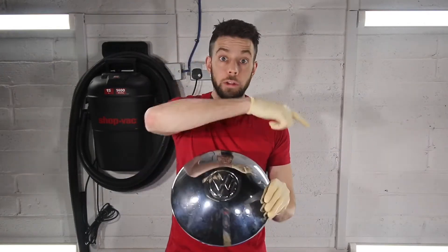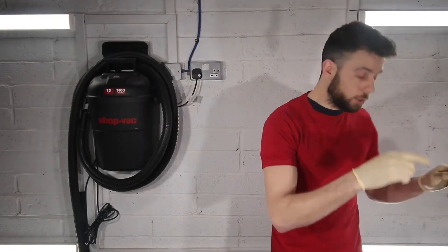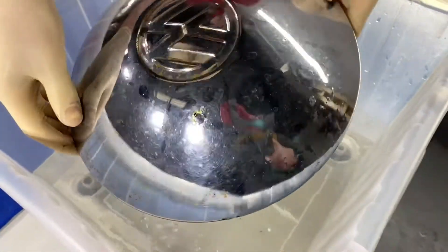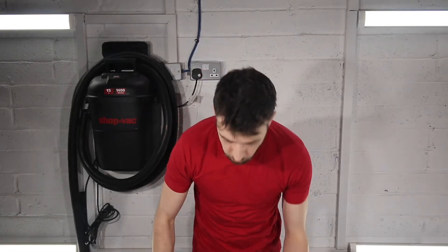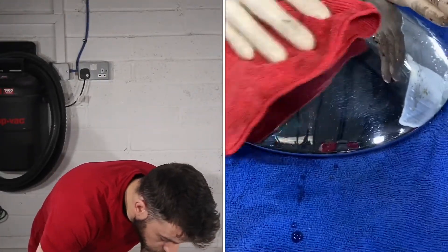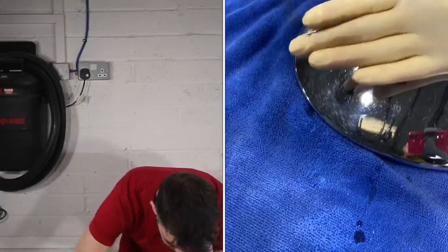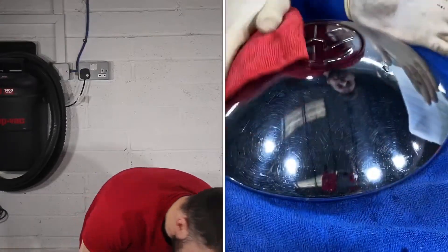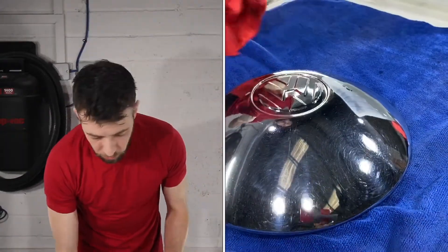I'm more than interested to see what's going on in the dip tank, so that's the next step. We'll put this aside and go ahead and remove this one from the dip tank — remember it's been dwelling the whole time we've been polishing and scrubbing. Carefully — it is dripping, so be careful as there is still acid all over this, and also rust. We have to clean it off with a nice soft microfibre cloth and wipe away the rust, grease, and debris picked up over the years. Irish weather is very harsh — a lot of moisture in the air — and classic cars unless properly housed don't fare well in Ireland compared to other climates.